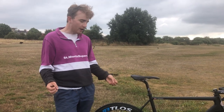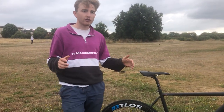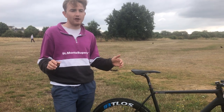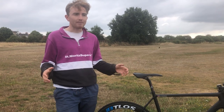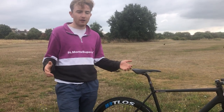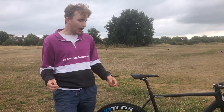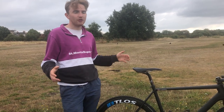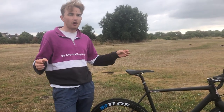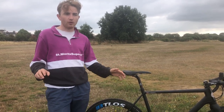They're 32 spokes and triple cross, so they're super strong. If you whack into some rocks, there's no stress about them going out of true. These are definitely the sort of rim you'd want for a gravel bike. They're about £290 plus shipping, which is fair for rims. You also don't have to wait as long as you would for a mainstream brand. Testing them on gravel and cyclocross first makes sense — if they survive that, the road rims would be perfectly fine.